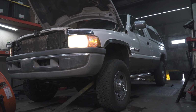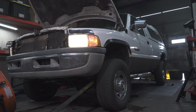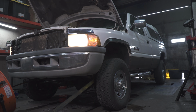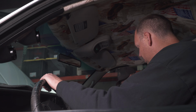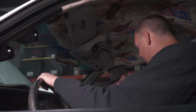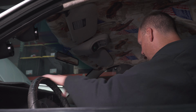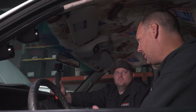All right, we were about 8 or 9 PSI on AFC Live. Working our way up to this window. We're at 1100. Boost slowly climbing. 1200. Okay, got it. 1300 on the dot. So we'll use 1300 as our peak EGT for our future testing on this sweep. We're going to try to tune our fueling to make that EGT on the sweep so we can compare power across the different turbos. So hopefully that'll make it work good.